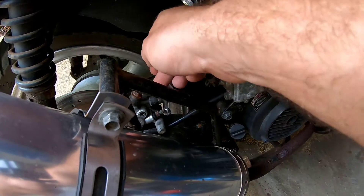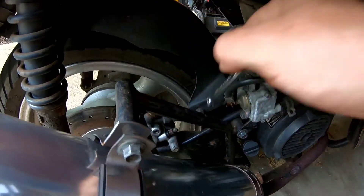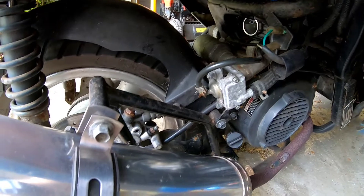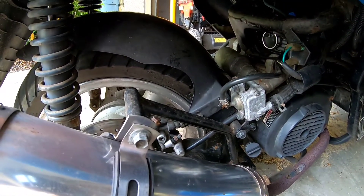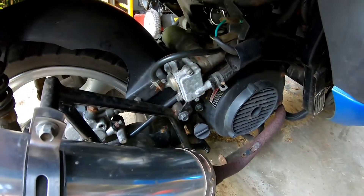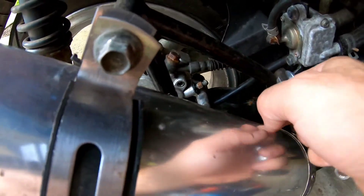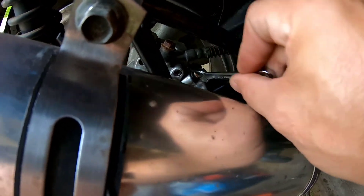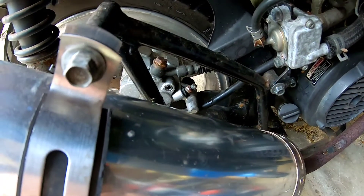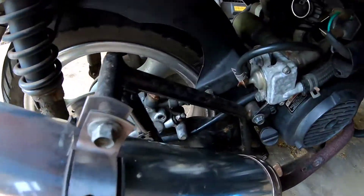This is a real pain to do at this angle — they've got a lot of little brake lines and brackets. I tried the impact wrench but it was too tight a fit, so I went back to a small ratchet. I managed to get the bleeder loose. Now we're going to pump it — there we go, I can see brake fluid coming out and dripping down. That's a plus — we have brake fluid getting to the rear caliper.